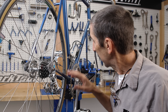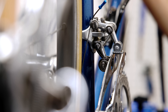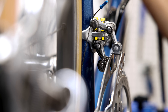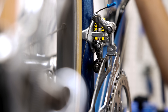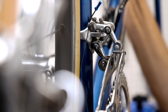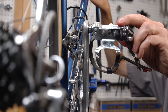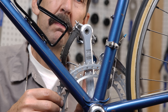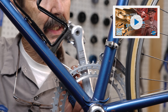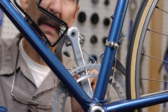We have the same basic concept up at the front derailleur. The cage moves via the parallelogram. The spring always pulls it inward, and these screws are used to limit the cage travel. The lever pulls and releases the cable to move the cage between these stops. But check it — this cage is actually hitting the arm. Remember these witness marks? Looks like it was the cage — we need to limit that a little bit further in.